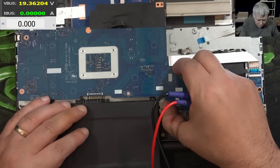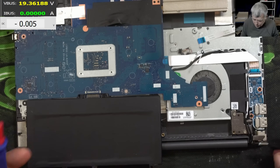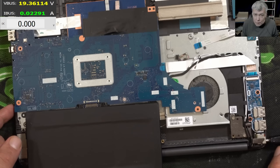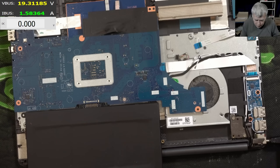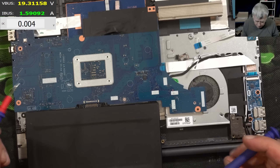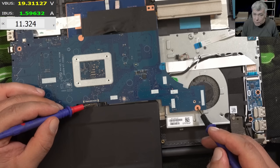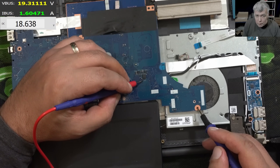I'm going to plug the battery back. Plugging in the charger — let's see, it should take 1.5 amps. And it's taking 1.5 amps, so the battery is charging. We can check: the battery voltage is 11.3V and going up, so clearly this battery is taking current right now. The voltage at the input of the first MOSFET is 18.6V.